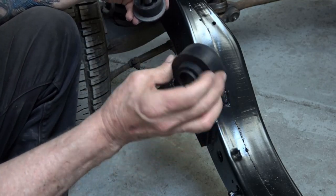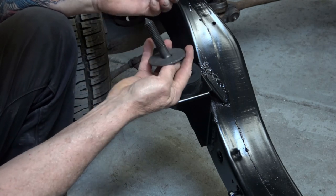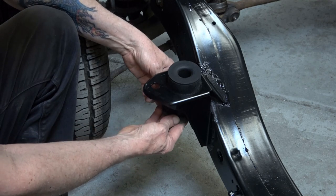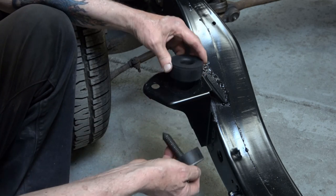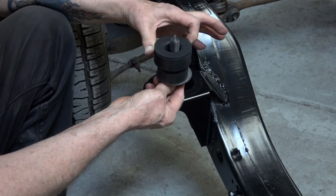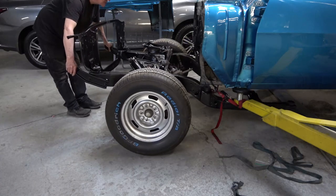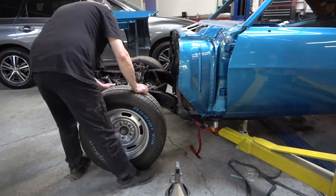Here's the core support all bolted in. I leave it loose so I can adjust it properly when I install the front fenders. On the bushings you put the hard washer down against the subframe, then put the mating piece from the bottom, then run the bolt up through and it screws into the bottom of the body. This is really nice hardware — you want to get the assembly-line-correct bushings and hardware because it'll be exactly like it was from the factory.